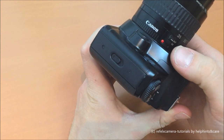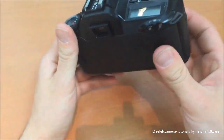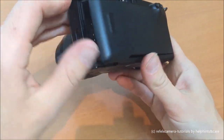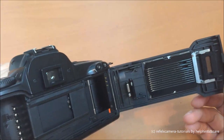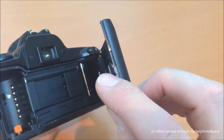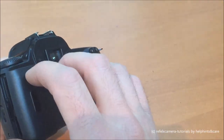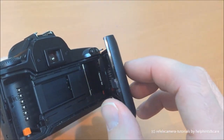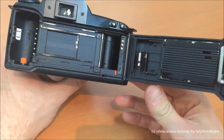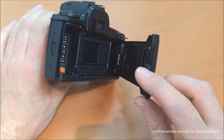Every lens also has the possibility to switch from autofocus to manual focus. Looking inside the film compartment — this of course is all made from plastic. One of the weak points again and again with almost every Canon EOS camera is this small bracket here. There's a danger it breaks, so the camera won't close. If you're looking to buy a used EOS camera, take a good look at this bracket — if there's even a crack in it, I wouldn't buy it.